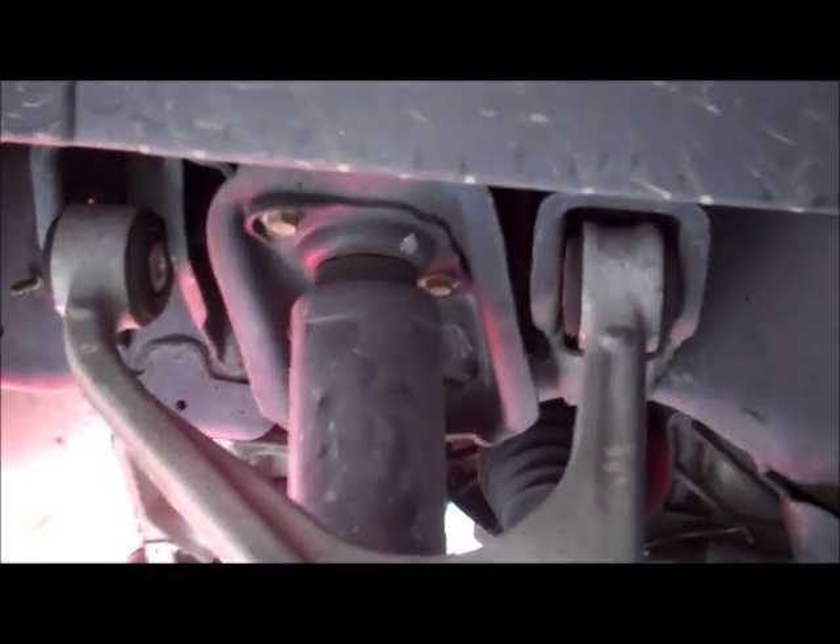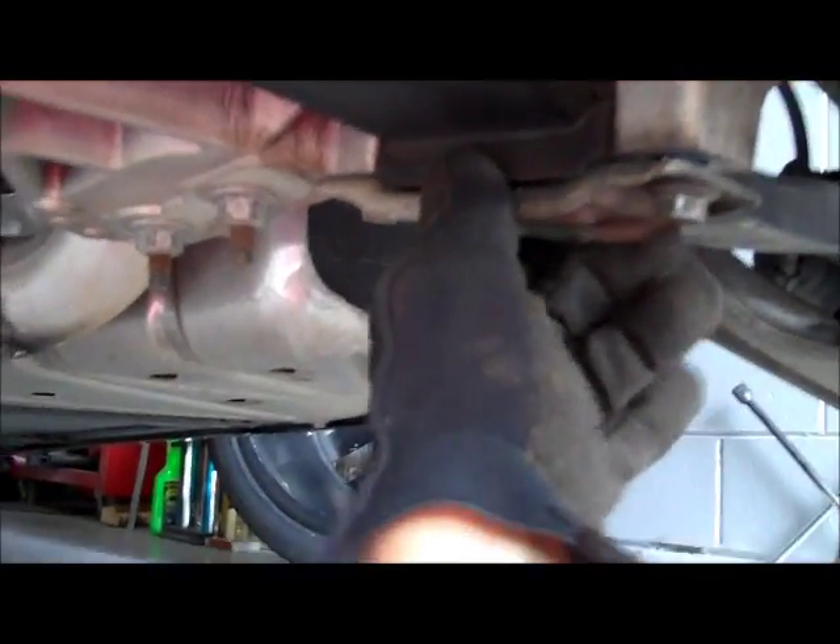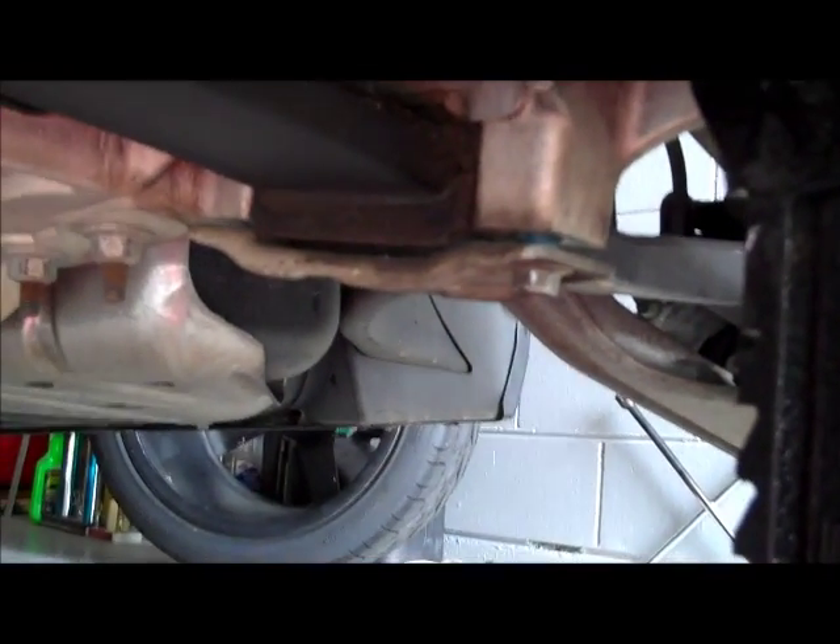You can see the setup here — I've got the lower control arm supported by the jack, a nice long breaker bar, and I'm getting ready to remove the two bolts for the upper A-arm. I've got the upper A-arm removed on both sides now, which relieves the tension on the spring. I've already started loosening the four bolts underneath, and as you can see there's pretty much no tension on these bolts right now, so I'm going to go ahead and remove them.